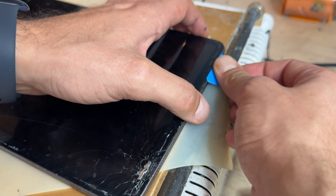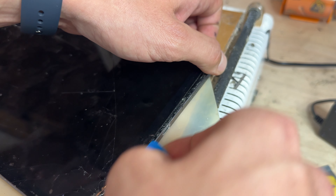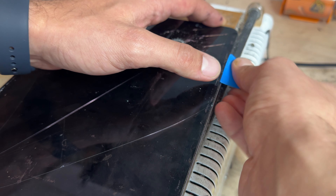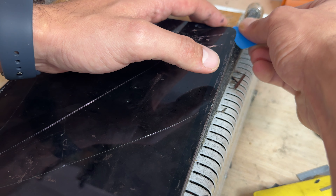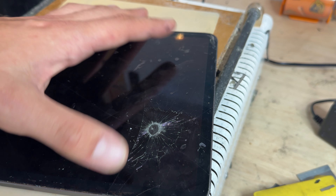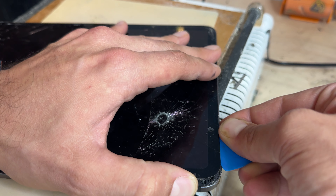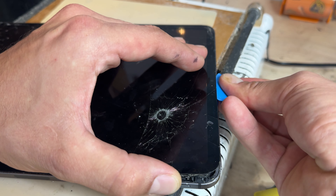Be careful around loose shards of glass because they can stab you in the finger — it hurts and bleeds. I'm always lifting up with the guitar pick to separate the screen and working along the right-hand edge. If there are cracked bits where you can't get under, lift it up more and get underneath. When you get to the top edge, be very careful because there's a Face ID cable — the proximity sensor is here, held by a very thin cable, so there's a risk of damaging it.